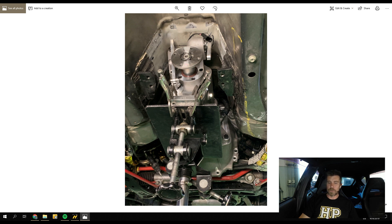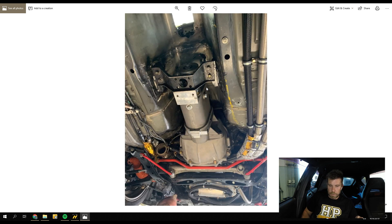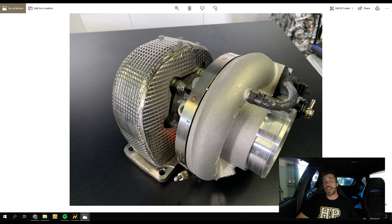Back on the laptop screen — we also have a Turbalone turbo kit for our Mazda FD RX7 that should be getting some progress soon. We're running what I believe is the one and only BorgWarner EFR 8474 turbocharger in New Zealand, which should be a great combination with the 13B engine in our FD RX7. One of the big challenges with any turbo installation, but particularly magnified in rotary applications due to the enormous exhaust heat they generate, is managing that heat.